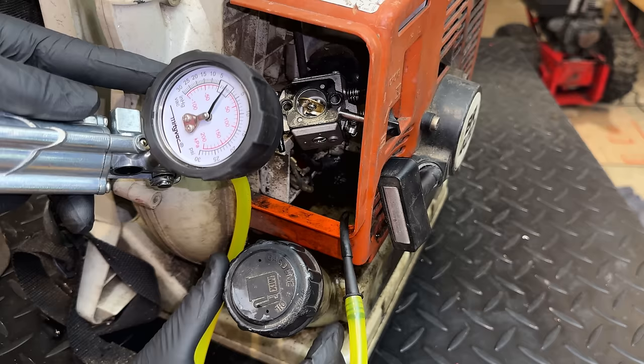And in case you're wondering, that is not a crack. This is a split case. So there's actually a gasket between the front and the back. So that is another possibility where we could be leaking. But given that it's dripping down the side, that tells me it's most likely coming from the base gasket. This ends up being it. I'm going to kick myself for not doing this sooner.